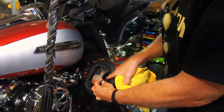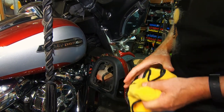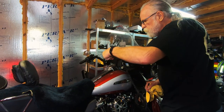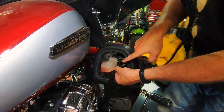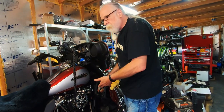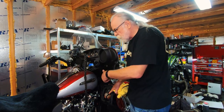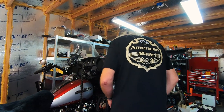You can see the coolant is right at the top, so this system probably doesn't need to be bled, but we're going to show how anyway. It's really simple: turn your key on and twist your throttle to at least 50% and hold it for three seconds. The coolant level goes lower but there are no bubbles. When you stop seeing bubbles it's bled. After we drain and refill, you will see bubbles coming up — let it run until the bubbles are done. If the coolant disappears, fill it up again.